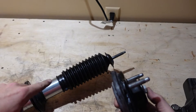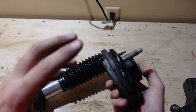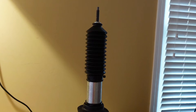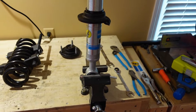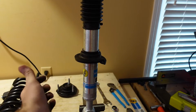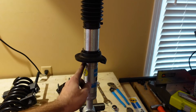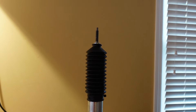To make this next process easier, I've got the shock mounted in a vice. The lower perch is in the correct spot — oriented to the outside of the truck — sitting on top of the snap ring underneath. The shock boot is up top, and the washer I just showed you is set aside because it gets in the way of the spring when installing.